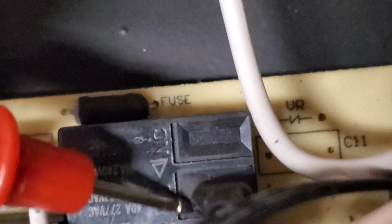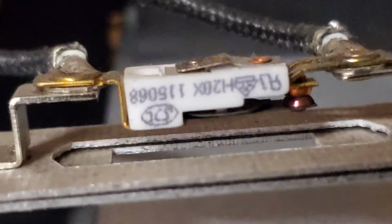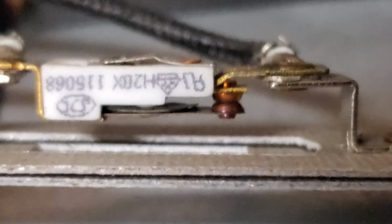So the 120 volts comes through this wire right here. The relay closes and gives 120 volts to this sensor right here, and all that sensor does is detect heat. It's a thermal. Now it's closed, and when it gets hot, it opens. So it's a bimetallic. It says, "Oh man, that's hot," and guess where it sits? Right here. That's the hole right there, so that's where the heating elements are. These are the heating elements.